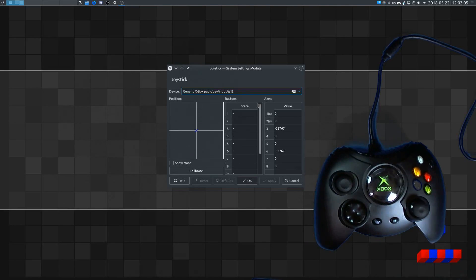Now I found one other problem with this controller in Linux. After getting the USB ID sorted out, I found that the controller resets every 40 seconds if there's no application reading from it. If you launch JSTest, Steam, or any game that is reading data from the controller, it doesn't reset. But once you close those applications, it goes back to resetting every 40 seconds. This wouldn't be a problem if it didn't rumble when it was resetting — it's quite annoying. But if you launch Steam and leave it running in the background, it becomes a non-issue.